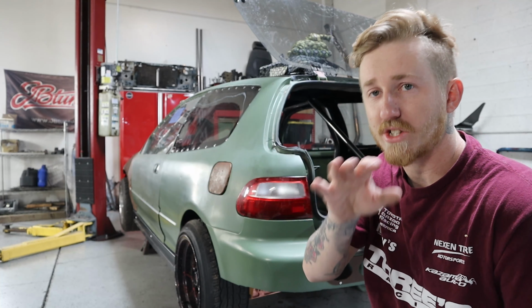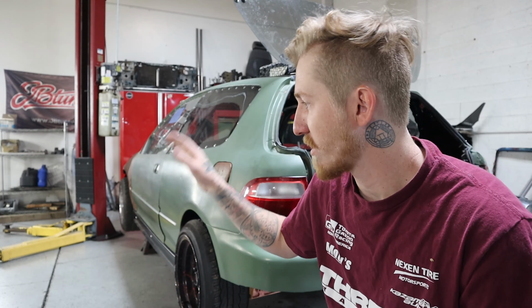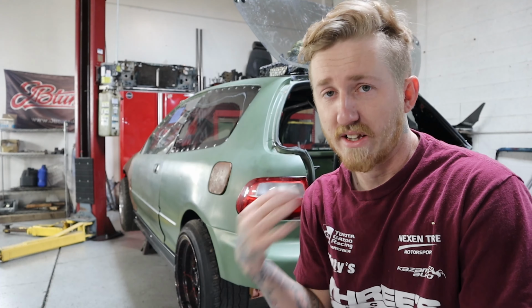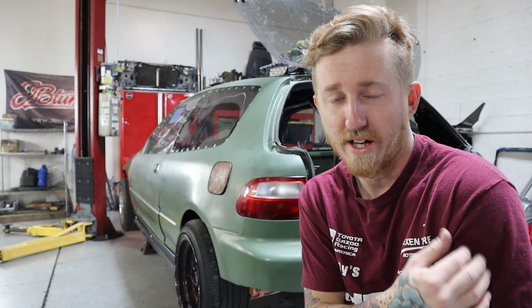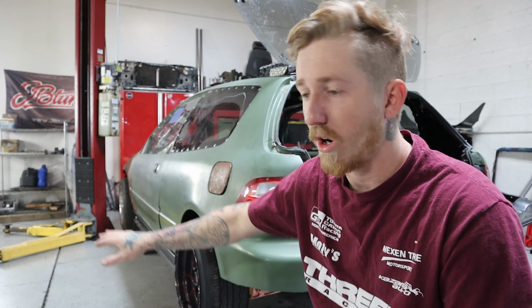Mind you, this is a pre-notched kit, pre-bent, pre-notched for most of the components, but all the notch angles are wrong. Like the door bars, they give you them notched at 20 degrees according to the instructions. They don't fit remotely anywhere. The notch does not fit at all other than almost vertical or parallel with the door, which is not how a door bar is supposed to be. Normally it goes from under the first bend on the main hoop around shoulder height-ish, and it goes down to the floor, and that one won't even fit. So I have to redo all the notches.